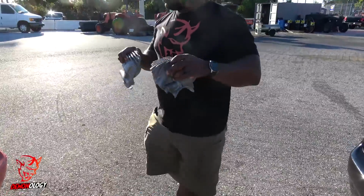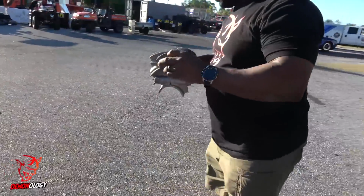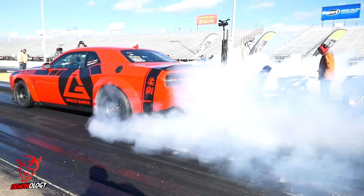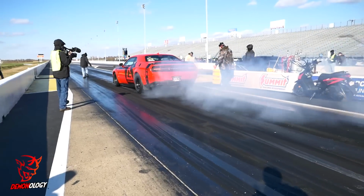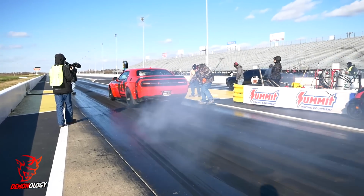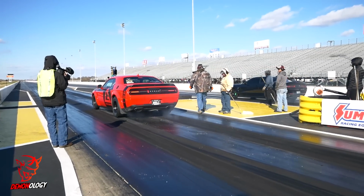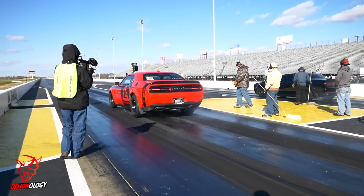If you're in your car and it starts to dribble, guys, get out of it. Let out of the accelerator. Now, the problem with that is when you do a burnout, Dodge specifically tells you that as that burnout is going, you want to ease out of the accelerator. Because if you just let out of the accelerator while you're using your line lock, you stand a chance for the tire hooking, and there you go. You're going to destroy the diff. You never want to let go of the line lock button and dump the throttle immediately at the same time.